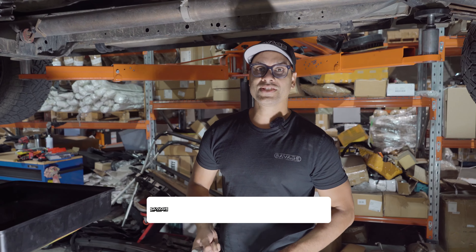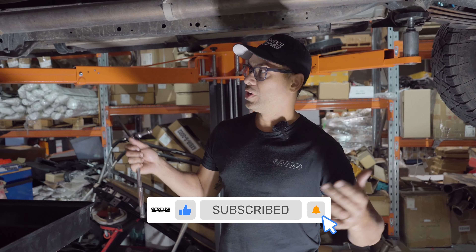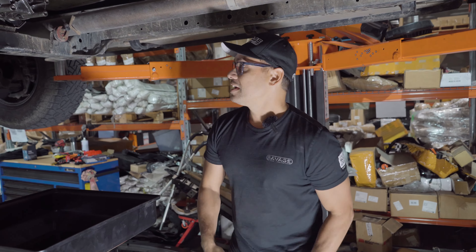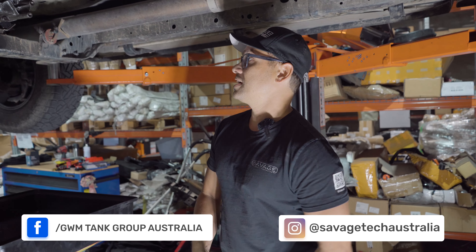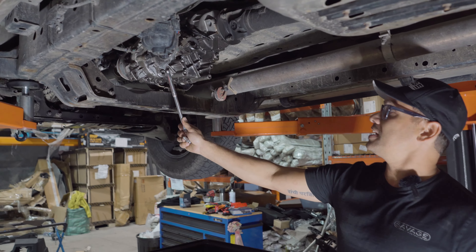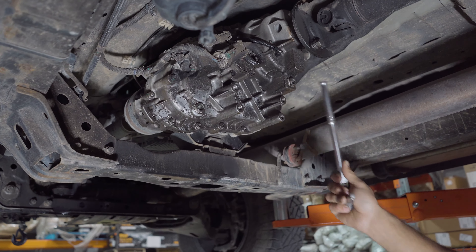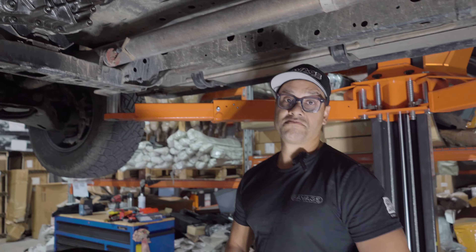While Martin's car is in, he's been complaining about a knocking noise from his transfer case every time he takes off. So we're going to change the transfer case oil. To do that, you undo the drain plug down below and the filler plug up top. That's your drain plug and your filler plug — let's get that underway.